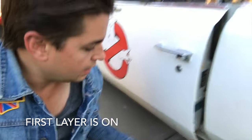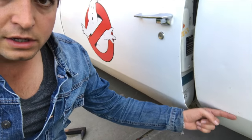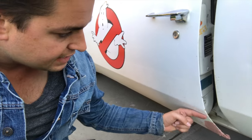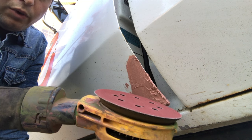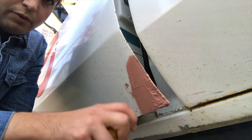Now that I have the first layer done on the bottom and it's just about dry, what I'm going to do is sand from this sort of belt line. You can see the body has this natural line — that's going to be easiest to try and match the paint from that point down. So I'm going to sand from roughly this spot down and very gently try and match the curve of the body so that I don't create extra waves or shapes. I'm going to fill it again and repeat until I feel like I've got the right shape for the lower portion, then skim coat it, prime it, and paint it. For this portion I've got the palm disk sander with 120 grit sandpaper and I'm going to work up and down and a little bit side to side to try and get that form.